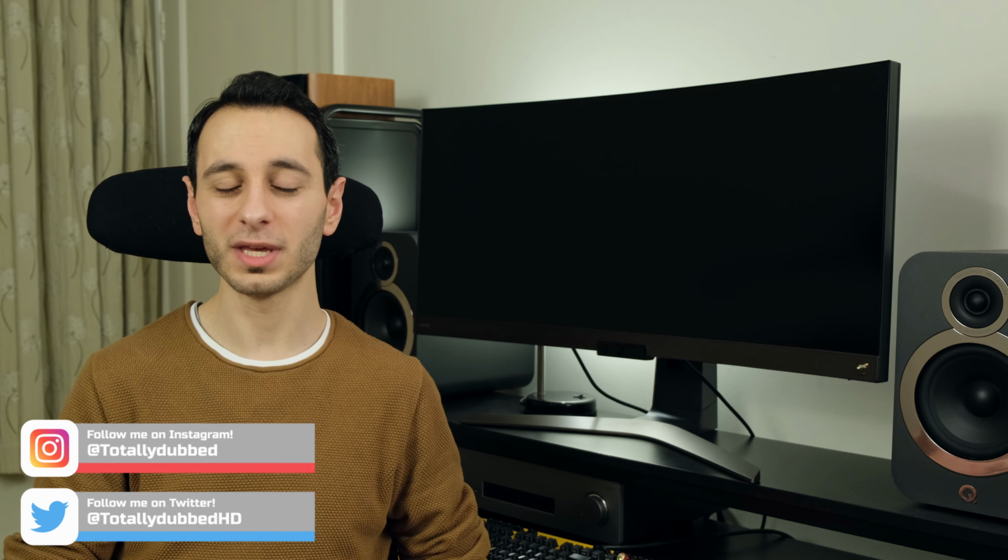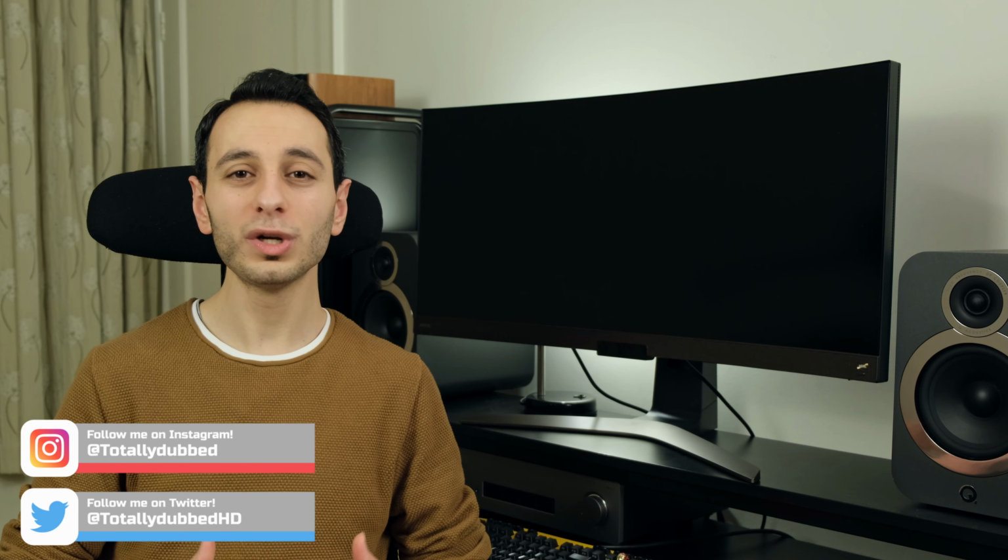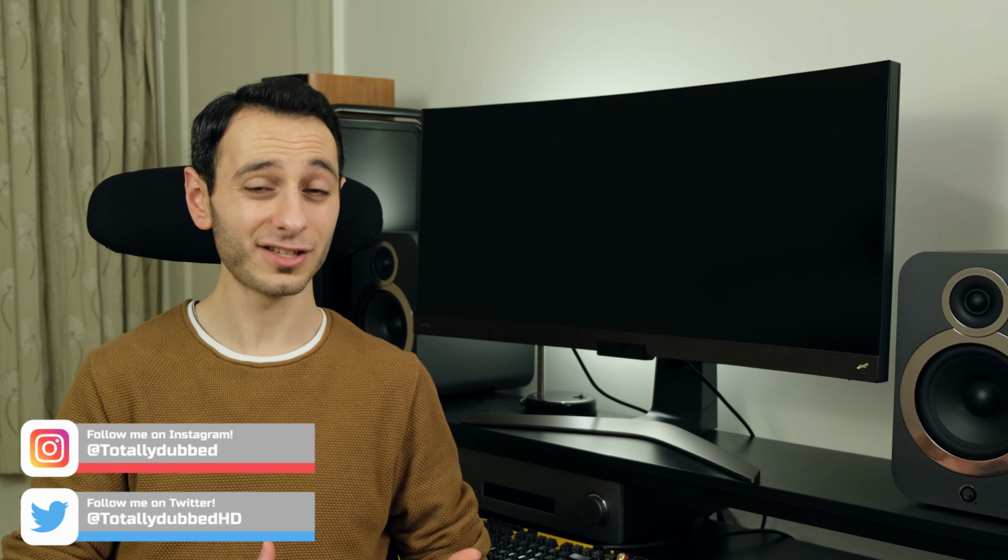What I'm trying to convey over here is that the overall color accuracy in sRGB mode, be it in Rec 709 or for example when you're running on the standard configuration, is just a little bit off, and it's quite a shame given the monitor's price tag that you would have expected BenQ to at least integrate an sRGB emulation mode for those people like myself who would be using it.